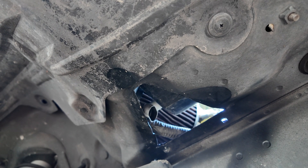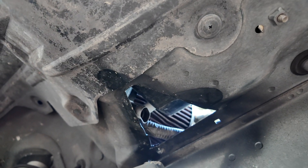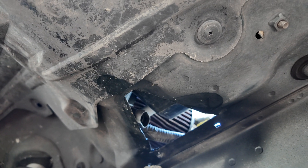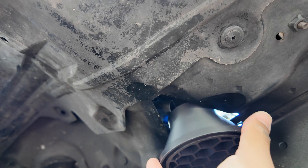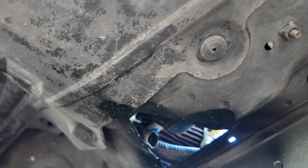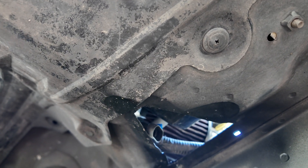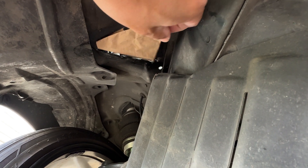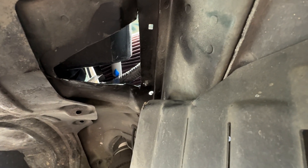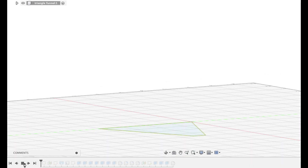I test fit the original triangle piece against the 2.5-inch circle — it was actually smaller, but apparently I'd already taken a grinder to it and made the hole bigger, so I do have the ability to fit the 2.5-inch in there. All I need to do now is make a template of this cutout and take that inside to start designing. I folded this piece of paper as a reference and also took a fairly straight picture to use as a template, and I'm going to go model this right now.